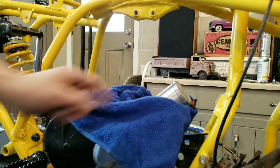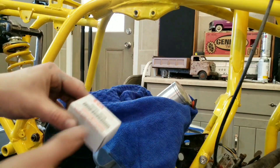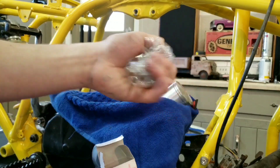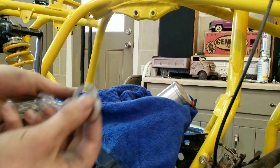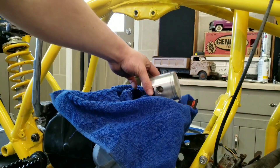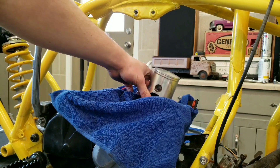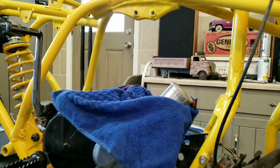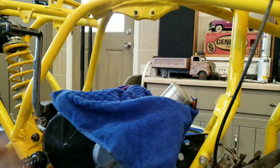What is going on guys, today I'm going to show you how to save your LT250R from blowing up. Is it as simple as this box right here? In this box I have these custom-made bearings and two billet thrust washers. These go in the piston, and I already installed it without these — these are very important to your engine. I only paid 35 bucks for these washers and this bearing, and that could save me from an entire top end or possibly even bottom end rebuild. The 35 bucks is absolutely worth it.